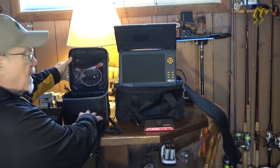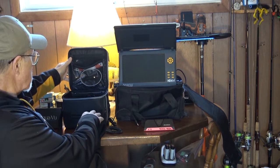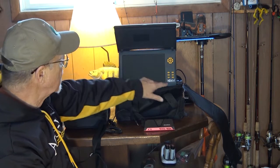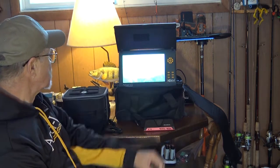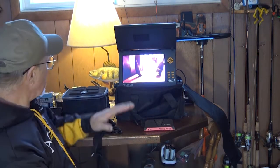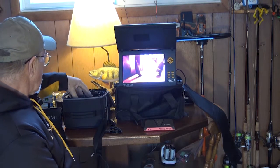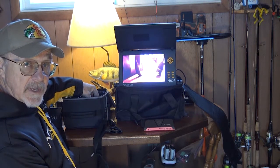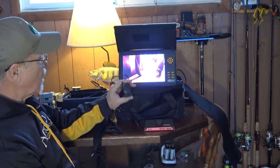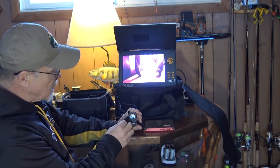This bag I've got, you can find these bags pretty much anywhere on Amazon, eBay, etc. What you'll do is measure it out for your extra battery. The battery on the HD 10i will last about two and a half hours — this is a 10-inch screen, so that is a lot of power draw. I've created a battery pack and external power by getting an 18 amp hour external battery, which will triple the life and get an entire day. I bought a motorcycle plug off of Amazon that has the power sources I'm going to need.